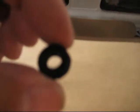Then you get your proper drill bit. What you want to do is check on your grommets. Grommets are going to have an inside dimension, an outside dimension, and then a grommet lip. The grommet lip on this is 3/8 inch, so that's how big these holes got to be. So what I need to do is take this license plate off and drill out both inside and outside holes and prime them and then put a grommet on it.